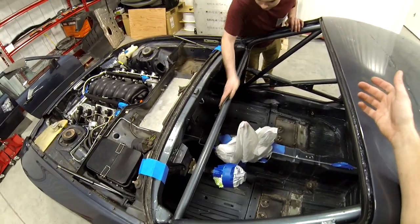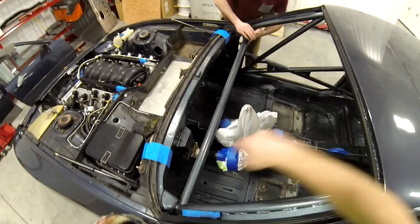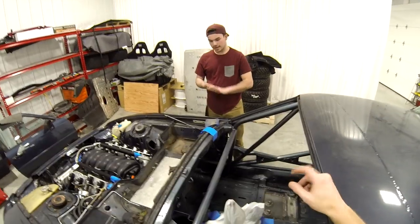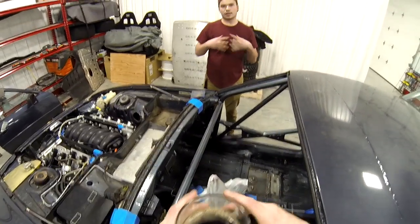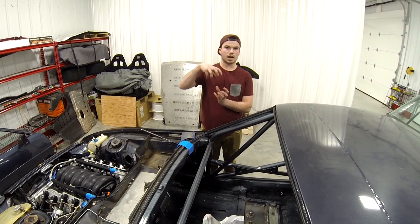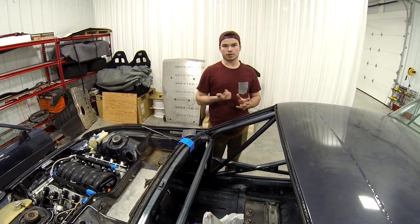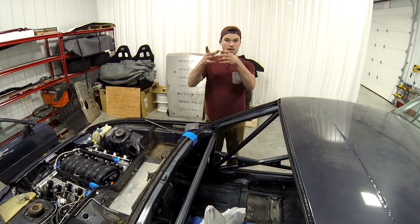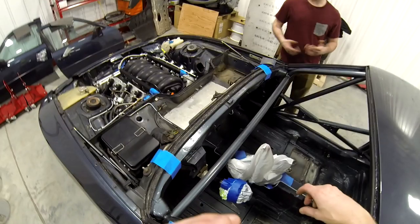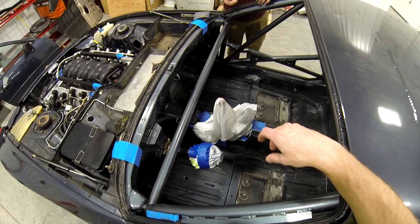So what happened is, I think they forgot to spray under this bar when they sprayed it, or whatever way they used to mask it prevented them from spraying it. Like my gun, I spray, they're called PPS cups. It's a plastic liner that goes in the cup on top of the paint gun, so I can actually invert my gun upside down and spray it. A lot of people run a traditional cup, which is just a metal cup on top. They probably didn't have the liner. The liner system is a perk to it. You pay a little bit more money for it, but then you can invert your paint gun.